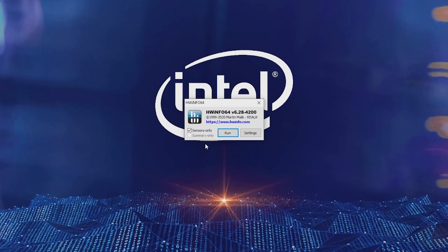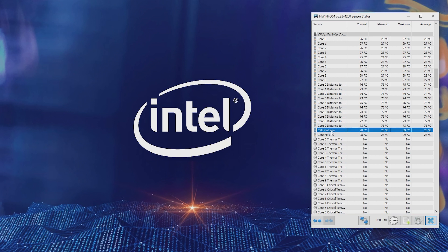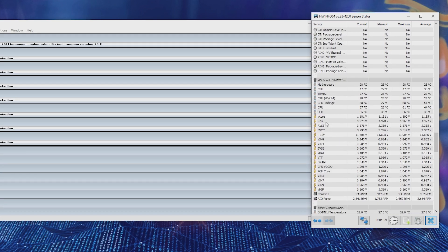Whichever you go with, the longer your system is stable, generally the better, but an hour or so is usually enough. You'll also want to monitor thermals during this process. HWinfo is a great option, as it offers real-time monitoring in addition to the min and max on a plethora of voltages, thermal probes, and even frequency. There's also the ability to record these values to a file which you can then graph. Run HWinfo in sensors-only mode and scroll down to the CPU section. Here, you want to pay attention to the CPU package — both the current value and maximum. Ideally this should be under 90 degrees Celsius, but AVX workloads are extremely power-demanding, so it's not crazy to see 100 degrees Celsius even with a good AIO. If temperatures look reasonable, leave it for an hour and come back to see the maximum CPU package temperature reached. It may also be worth scrolling down to the motherboard section and taking note of the maximum V-Core that was required, though be aware that motherboard software voltage readouts aren't known for being accurate, so only use this value as a guide.